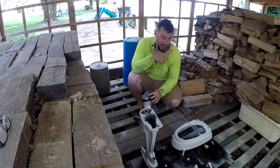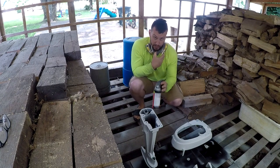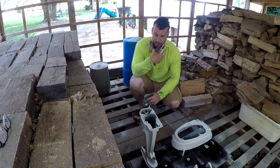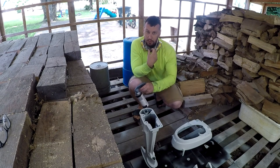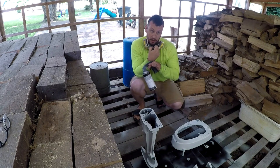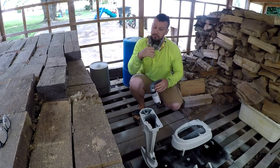If you're using a spray gun, even a rattle can, don't start spraying directly on the piece. Give it a couple of spurts off to the side, just in case there's anything on the nozzle, and it gives you a little bit more control, okay? That way you don't get a real thick, heavy spot right off the beginning and go, ugh, damn it. It prevents that.